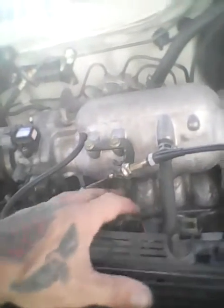where does it take from? It takes from the intake exhaust gas that comes from the PCV from the engine, gets sucked up into here, then it goes out over here through the purge out to the canister. That's how it's supposed to work, but it's not working because it's not getting that control voltage. So we're gonna suss it out. We're gonna get to the bottom of this by cutting the rest of the tape off that wiring harness.